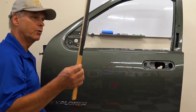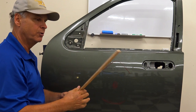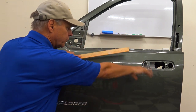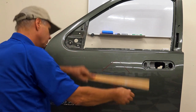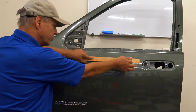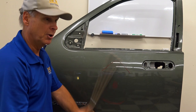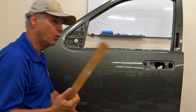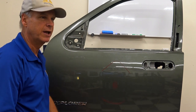And if it's a very soft crown, let's say it's a very soft pressure trap, remember we talked about, go to Home Depot, get yourself that really expensive free stir stick, put about 2 cents worth of Gorilla Tape, one layer only, you put it right on that soft little pressure trap, bang, bang, bang, bang, bang, with a hammer, take it down, a little bit more, bang, bang, and put your pinstripe there so you can see it in the reflection. And until that pinstripe's nice and thick, go to the next one, take them out. Metal slapper works better, but this is free. If you get overzealous with a metal slapper, you can sometimes make more damage.